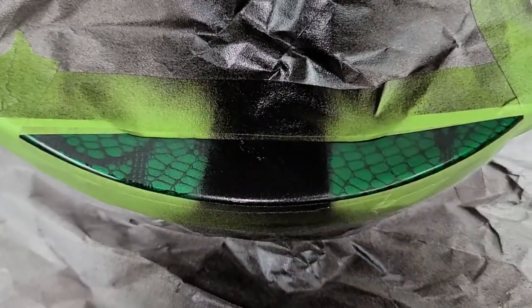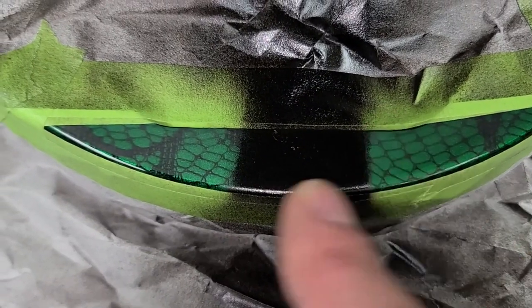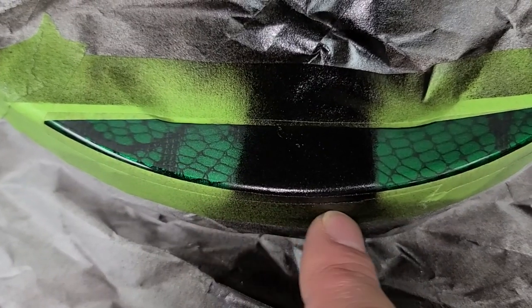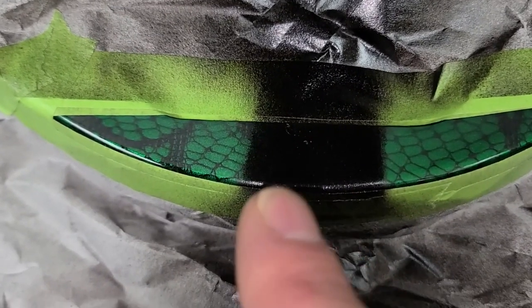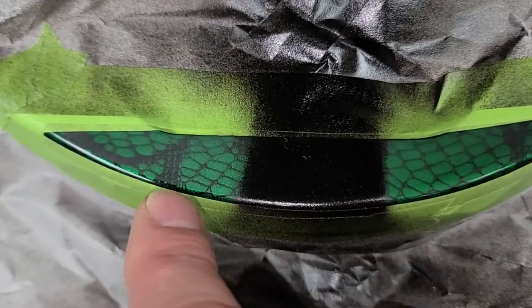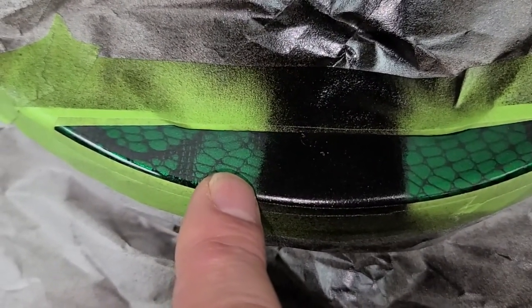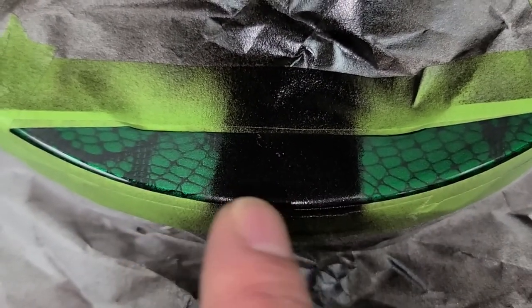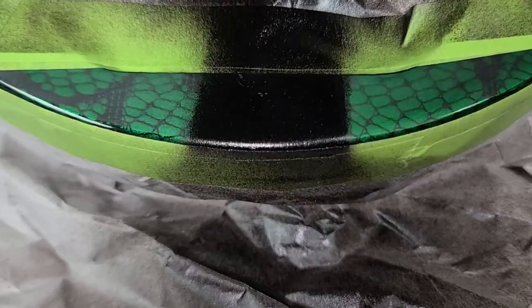I'm pretty much dry to touch here and I don't even see the damage anymore. If I were to just put straight tape on each side — like I did on the bottom — that bottom part I could sand out with no problems since it's on the edge of the body. But on the top, with that rolled piece of tape, you don't have a real straight fine line edge; it's kind of fogged in a little bit. That is going to help me feather in the edges and wet sand this a lot easier.